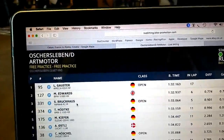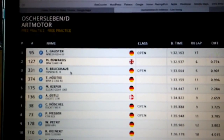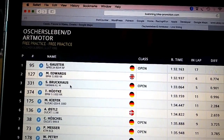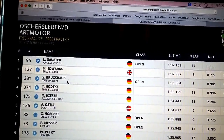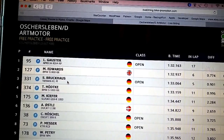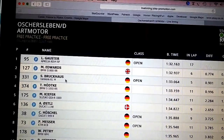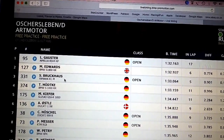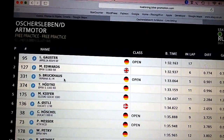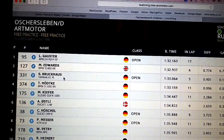That session I tried a slightly different tack. I've been running with a lot of traction on the bike, so I've wound quite a lot of traction off — on my minus three traction which is about half way from being off. And the difference now is that when I was opening the throttle previously the bike was slightly delayed and paused before going, now it's going straight away. I'm getting a little more wheel movement but I'm actually driving forward. I didn't try any harder at all — I just did what I normally did. But it felt so much sharper out of the corners.